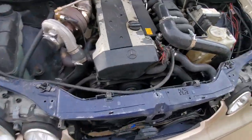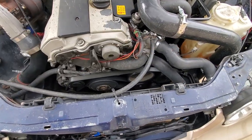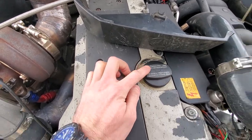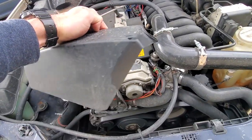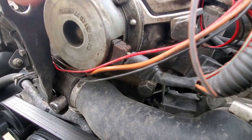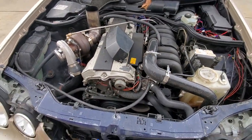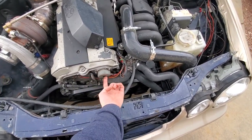I've noticed that there are a couple little drips underneath the car and I don't know where they're coming from — it's nothing too bad. I was able to solve the oil coming out of here with just another oil cap. Looks like that's all the problem was. It is leaking just a tiny little bit, but that's probably because it's corroded in there from the magnesium. One oil leak I have for sure is coming from the plug right there on my intake cam advanced solenoid. So I got to figure that out — I might take the other one apart and see if I can reseal it correctly.